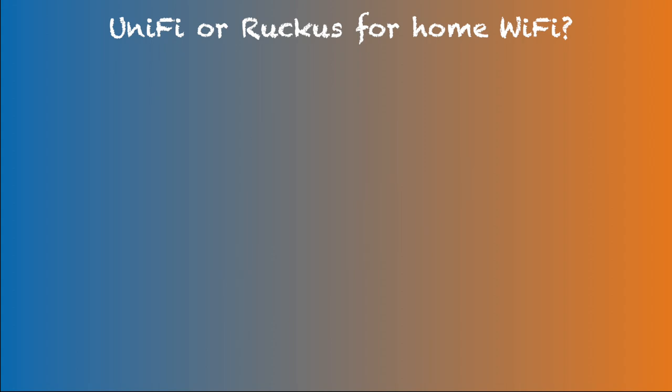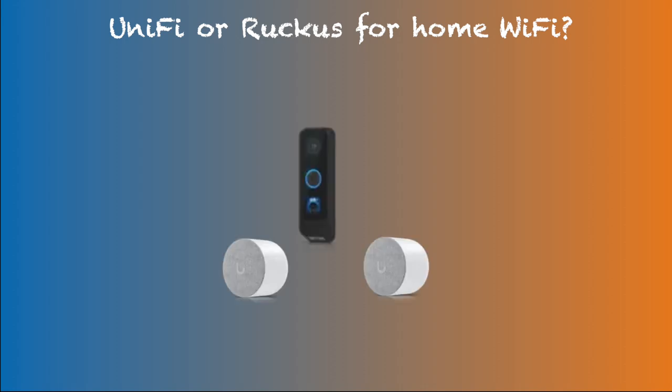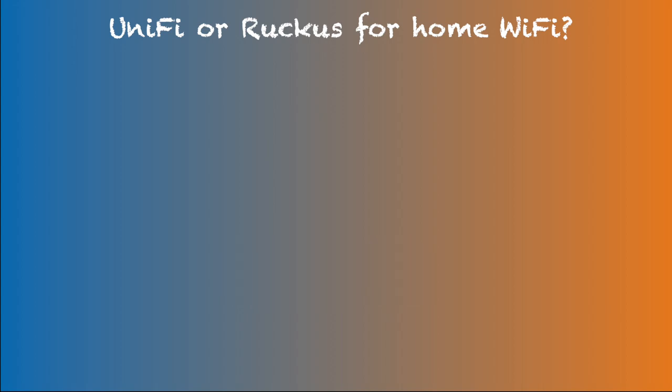Another group of devices that lost Wi-Fi connection were UniFi's own gear — UniFi Doorbell Pro and its associated two chimes. This turned out to be simply a configuration issue. For these devices, UniFi had created its own SSID, so all I had to do was go back to the UniFi controller settings for the Doorbell Pro and change it to the IoT network, then factory reset the two smart chimes and reconfigure them to connect to the IoT network as well. This process had no issues. Overall, I think both systems are highly compatible with various types of IoT devices.